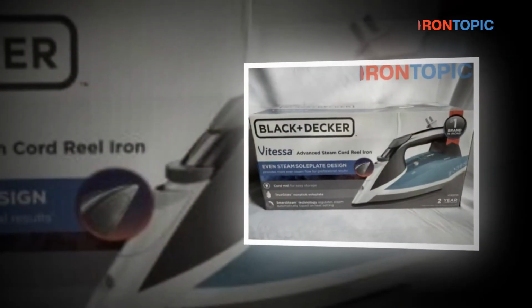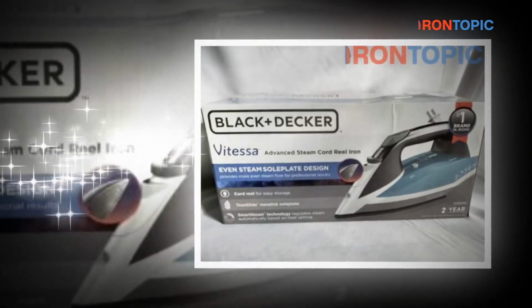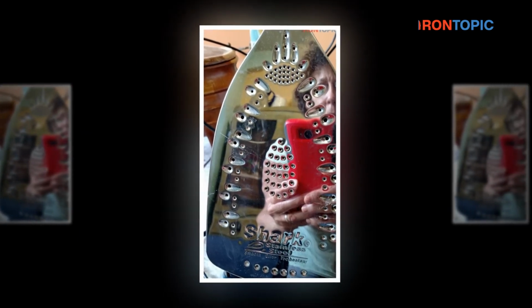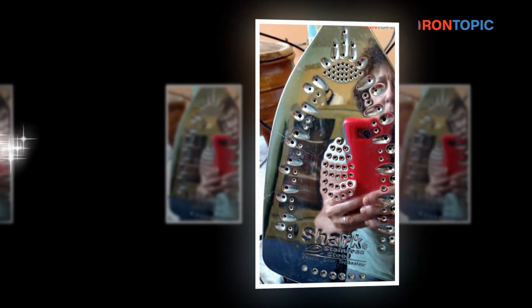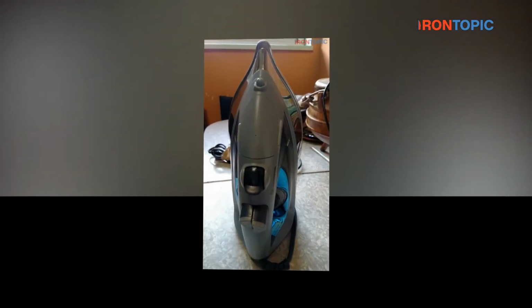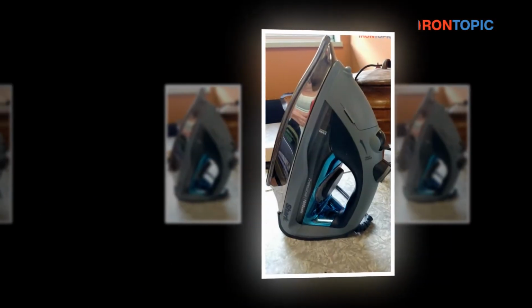Disconnect the iron and allow it to cool for 30 minutes. Use 2 glasses of water and 1 drop of washing powder to fill a pan. In the mixture, dip a sponge, wring it and clean the sole plate. Mix 1 cup of hot water with 1 cup of vinegar and 1 teaspoon of salt if rust and corrosion remain. Use the solution to remove the oil. Scrub the sole plate with the mixture.